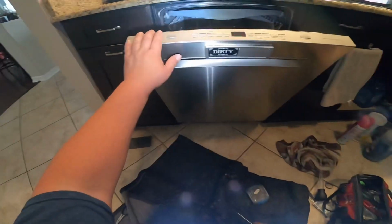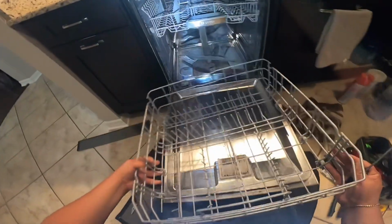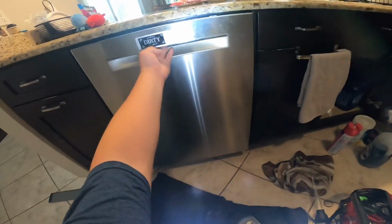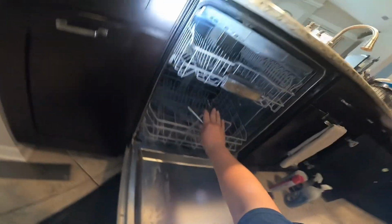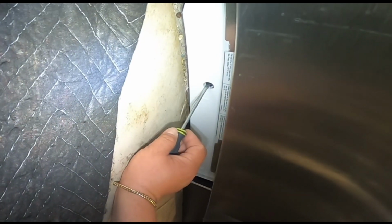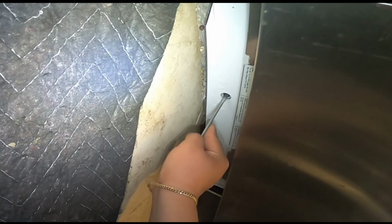If you have to adjust the legs a little bit more, loosening or tightening, just do it after you do the two screws on the top. You can keep adjusting and leveling the dishwasher with those two screws on. That is the good part about those clamps being flexible the way they are. Now, if that drawer falls on you, like trying to come out by itself, that means the two legs in the back have to be adjusted, so that the drawer stays in place. I have many times had to adjust this screw, which, like I said, you can see the arrows there. It tells you where.